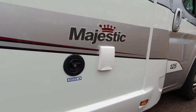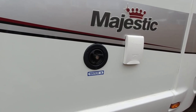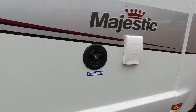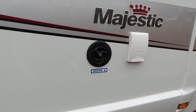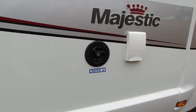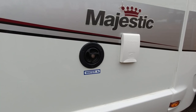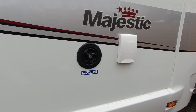That's where we fill the water on this model. The 125 — you can see it says it on the door there. I think the tank is 90 litres. I normally run a hose pipe round and fill it — we've got various hoses that we use at sites. The gauge in the van isn't brilliant, so generally I time it. You can get a little gadget that goes on your hose that tells you how many litres you put in — they're about 20 quid. The only other way to gauge that you've got it full is it gushes out the overflow underneath the van, but it's not sensible doing it that way.